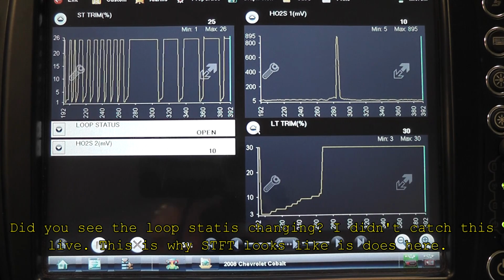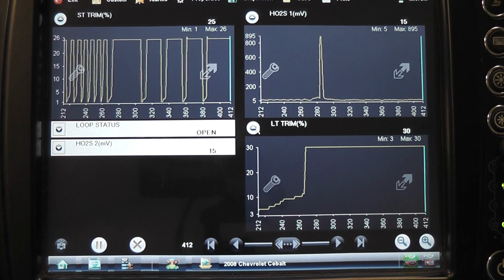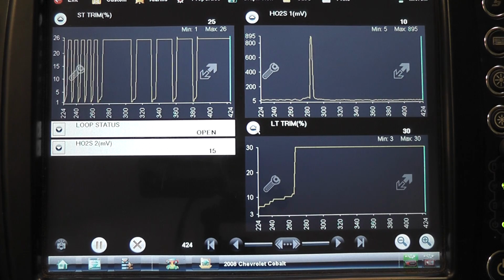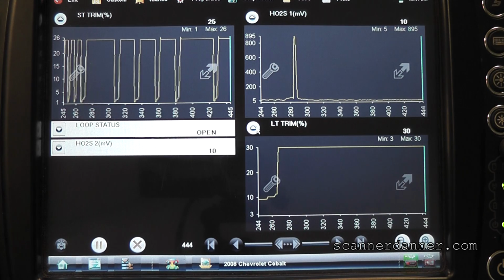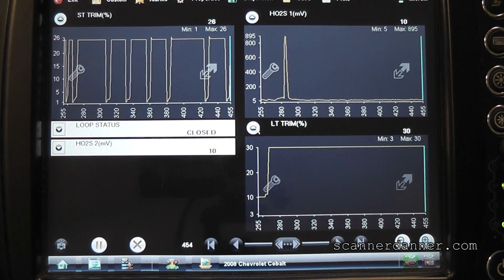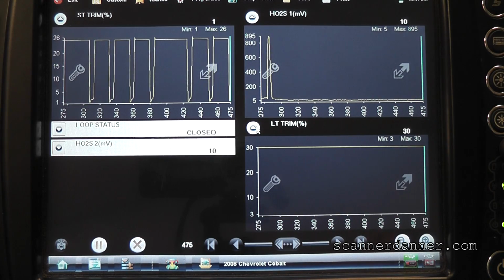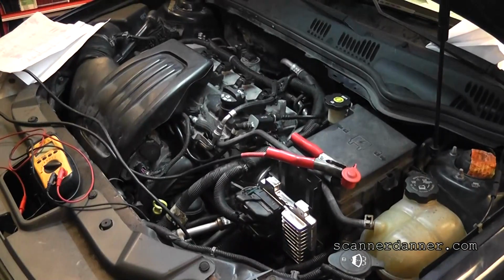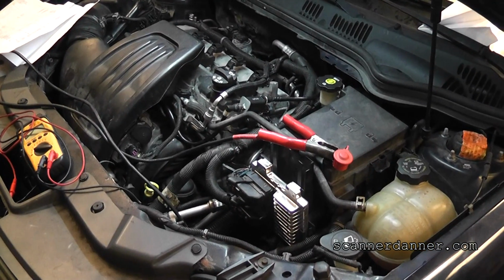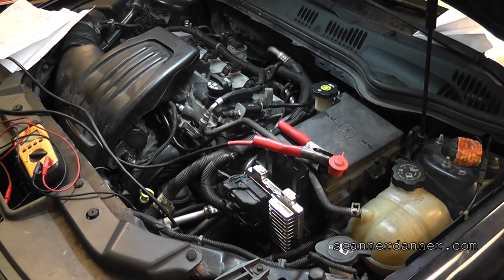Vacuum leak. But here's the thing, is this car fixed from a standpoint that we now know we don't need an engine? The crank sensor was the main thing, it was left unplugged, we did a crank relearn. Some bonus material here. Let's find this lean condition. Let's do some quick checks under here. Why don't you guys come up and join me under here? Or I could show you with the camera right here if you want. You can see what I'm doing. Just try not to lean on the car or move the car.